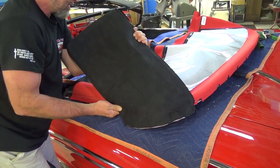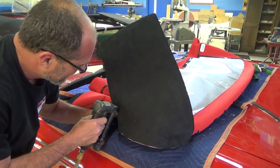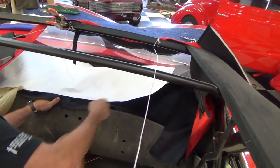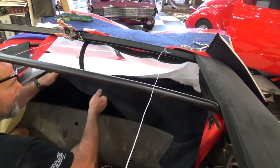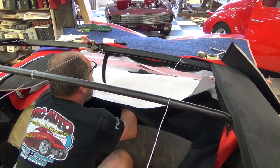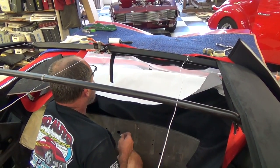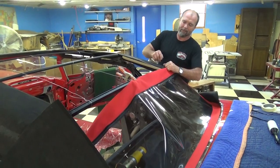These things are a pain to get exactly right, so I may have to pull this out and redo it — we'll find out here in just a second to make sure I got the angle right. The tack strip that I showed you sitting over on the table — now that we've got the glass and the pads on, we've got to attach it to the car. You set it in the car, then you lift up the deep well right here, find your bolt holes working almost in the dark, line it up and put your bolts into the body. The body already has threaded holes. We have the tack strip all tacked to the back of the car — now it's time to staple this down.